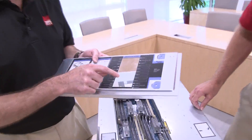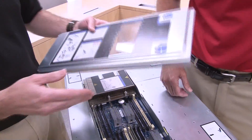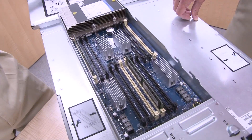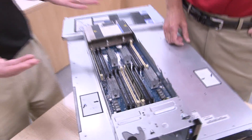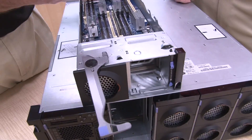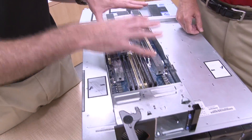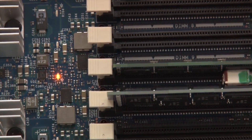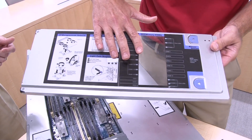The cover that was removed has a clear panel that allows you to see what DIMMs are installed, and more importantly to see if there are memory faults. This panel lets you see if there are any LEDs lit up in case a DIMM fails — that is our light path diagnostic system. There's a button at the front: if you press this button while the compute book is out, it activates the power subsystem for the compute book to display those LEDs. If any DIMMs have failed, that will light up the LEDs on each particular DIMM — one LED per DIMM — making it very easy to identify which components have failed, quick to replace, and get the system back up and running.